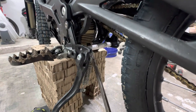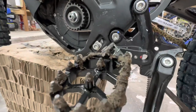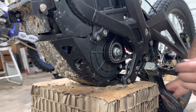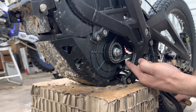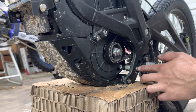Then we can go and tighten it. We're going to do the same thing but come under the bar this time. Put a little pressure on it, and then we're going to tighten this allen head up on the side. Be ready to rip. When you're prying it, grab this piece right here, push up on it and it will click and just stay there. Feel the tension of the belt when it feels good, go ahead and get your allen wrench and tighten your bolts up.